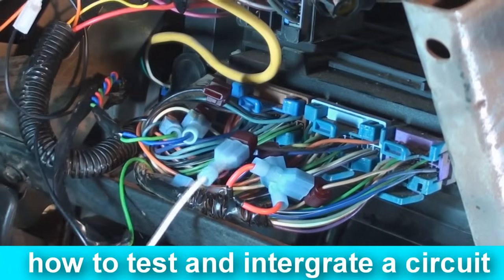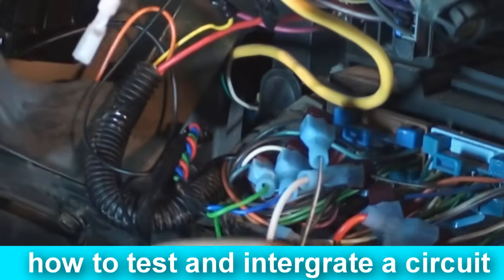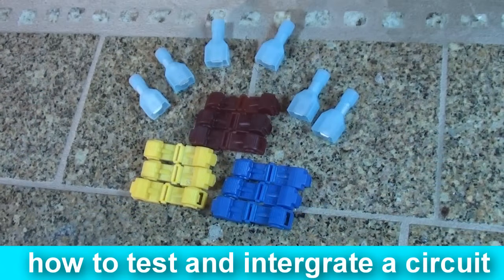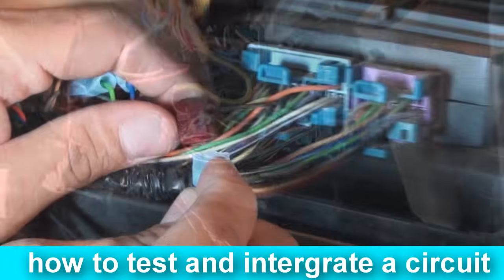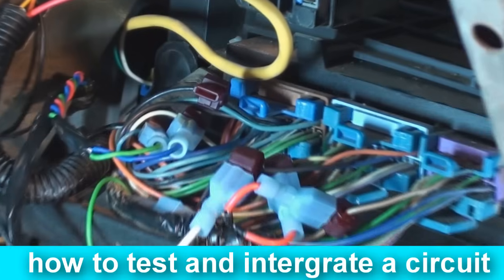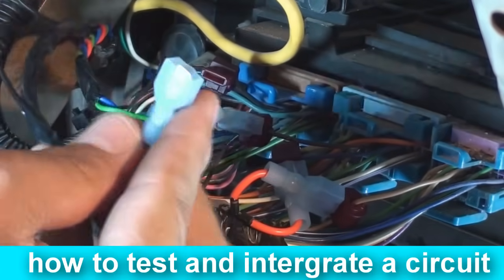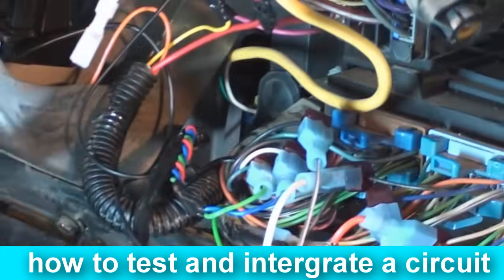T-taps integrate into the wire by biting down on the circuit. When using a T-tap, it is very important that you use the correct size tap for the wire gauge you are integrating into. There are three sizes of T-taps, easily identifiable by color. The red tap is used for smaller wire, 22 gauge to 18 gauge. The blue tap is used for medium size wire, 16 gauge to 14 gauge. And the yellow tap is used for thicker ignition harness wires such as 12 gauge to 10 gauge. To use a T-tap, you will need a pair of pliers — insert the T-tap onto the wire, then clamp down on the wire; you should hear a click. Once the T-tap is in place, crimp a male connector onto the wire that will be inserted in. Make sure to use the proper male connector based on the gauge of the alarm wire, not the circuit you are interfacing into. The number one reason these connectors fail is due to using the wrong size connector on the alarm harness and using the wrong size T-tap.